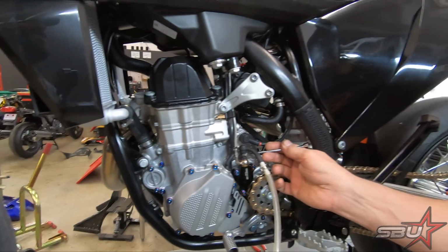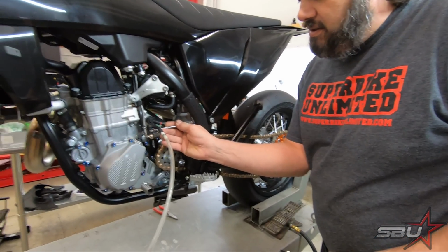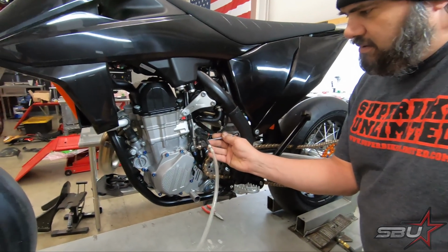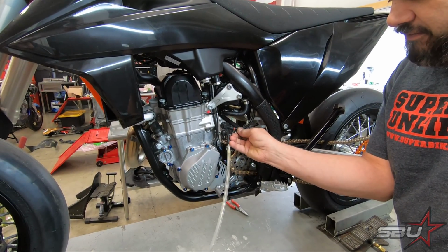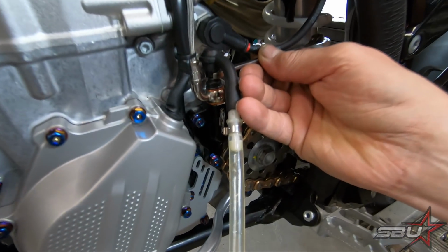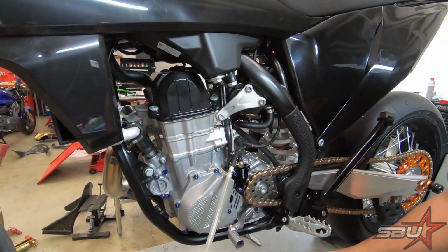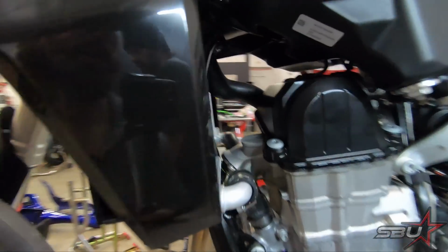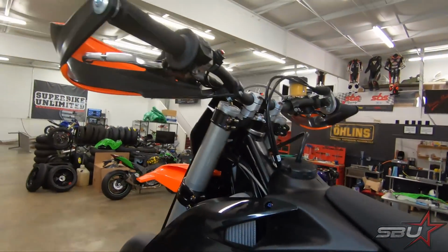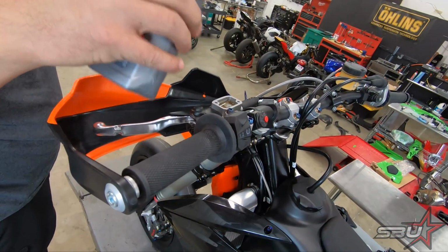And do you pump this once it starts pulling through? I do it with the vacuum bleeder at first until I start getting pretty solid fluid through there, kind of like how it's starting to do now. Okay. And then once I get a lever, I'll pump it and crack it to finish it off. Got it. Suck it down a little bit.